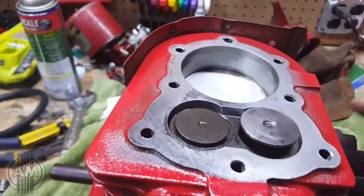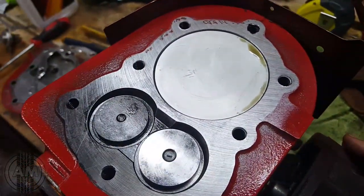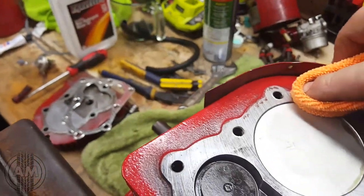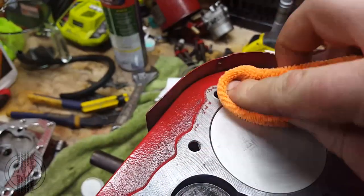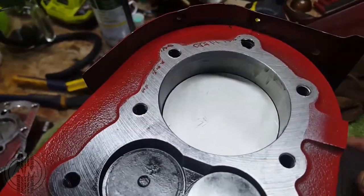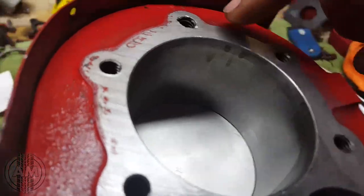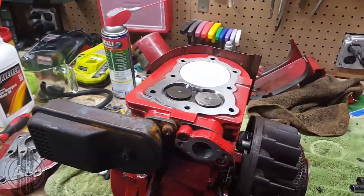After that we did start to get a little bit of blow-by, but that's minimal — hardly anything. This could be because the rings still need to seat, and they only really seat when the motor gets warm so the rings can expand. There's a little drip here, a couple drips there — but that's not bad at all. Let's slap it together and take it outside and see if it runs.